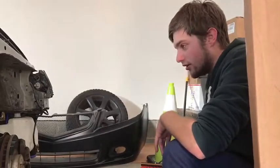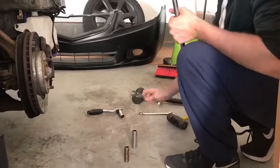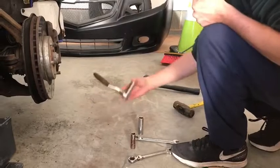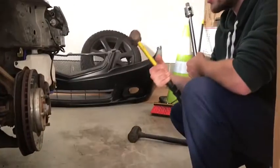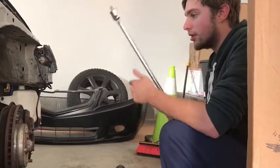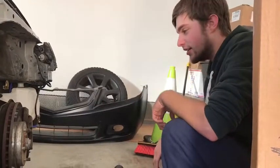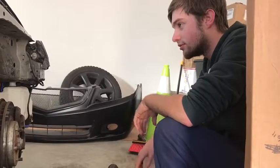The things that you're going to need for this setup are a few types of 17s and 14s. I have a 17 socket, a 14 socket, a 14 ratcheting wrench, and a 17 ratcheting wrench. That's not ratcheting. I have one though. Ratchet with another 17. The hammer usually needs this to come out, but sometimes you can get it with a rubber one or a claw hammer, whatever you have. And then I use a breaker bar just because sometimes the bolt on the bottom of the fork, there we go, gets stuck sometimes. So that's pretty much it. Pretty simple setup, and let's get into it.